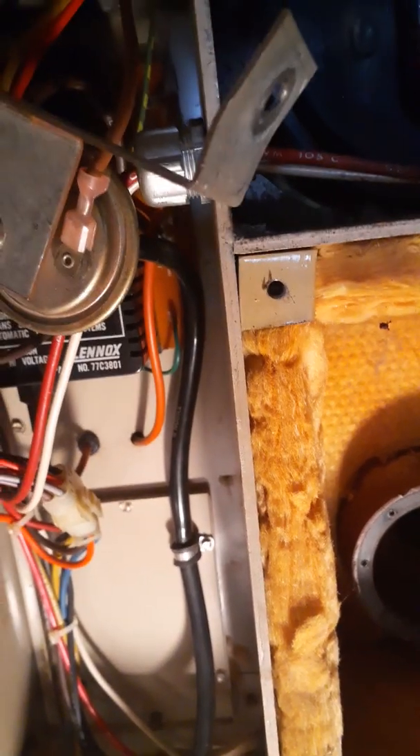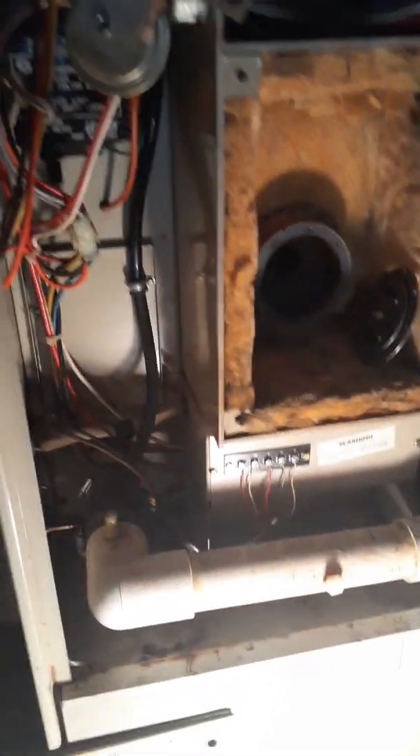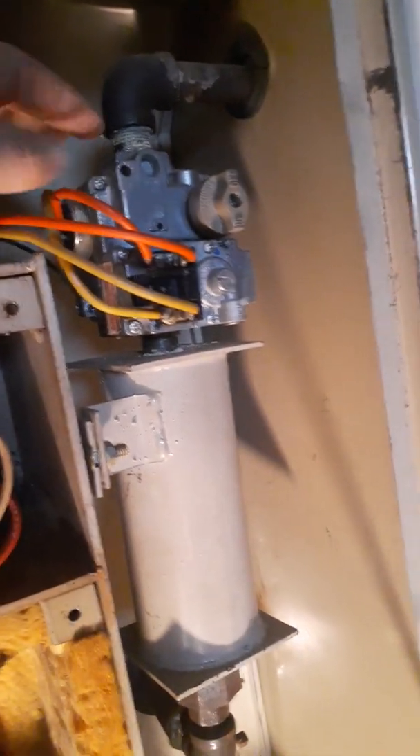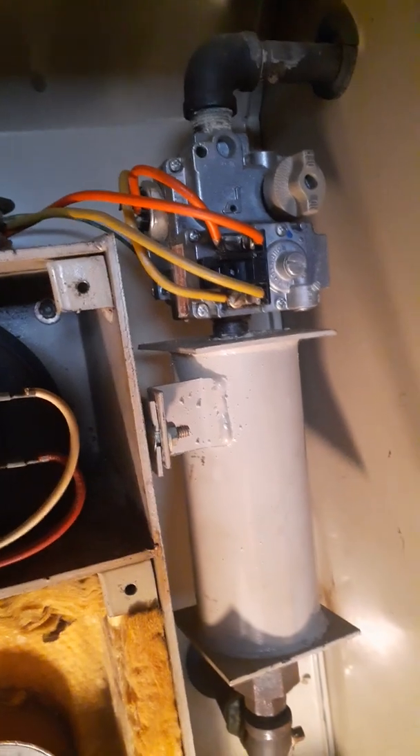I could hear it trying to start — the high voltage was clicking on, you'll hear a buzz — but no fan was going, I could hear nothing. I decided to check the connections up here. Right here is your gas shut-off switch. I pulled it off with a flathead screwdriver, took the whole wire off, fixed the lead, and cleaned up the connections with sandpaper. I tried to start it again, got the buzz, but didn't hear anything else.